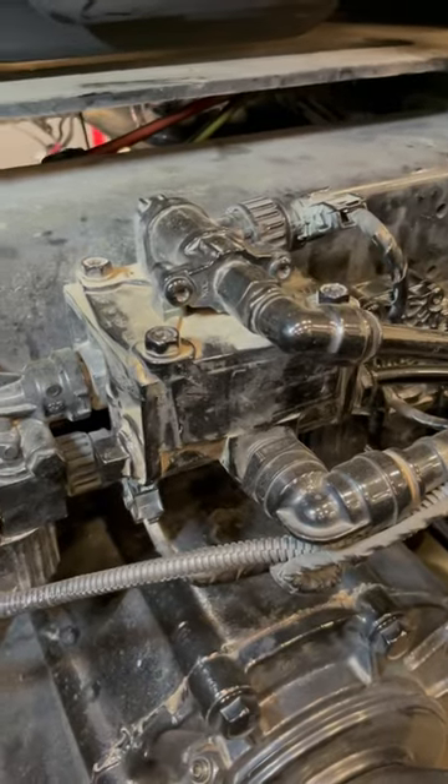If you have a single rear axle, your relay valve remains mostly unchanged. You have your modulators on both sides, but the front ports have been plugged. One of the front ports is solely used for the anti-compounding valve.